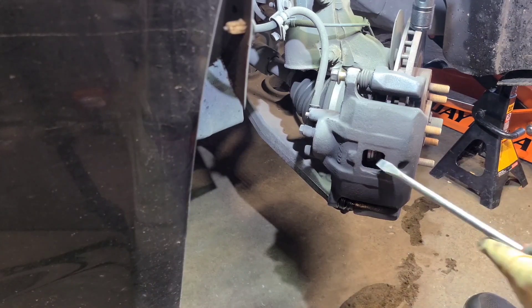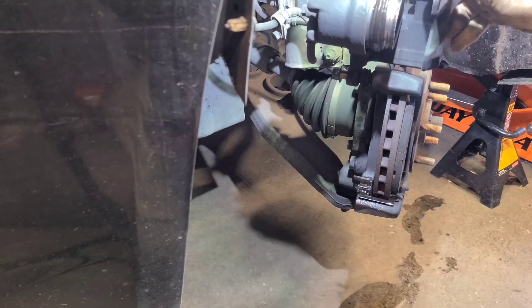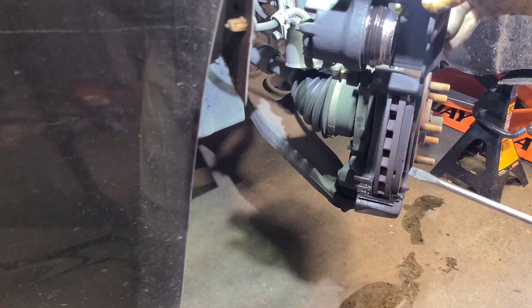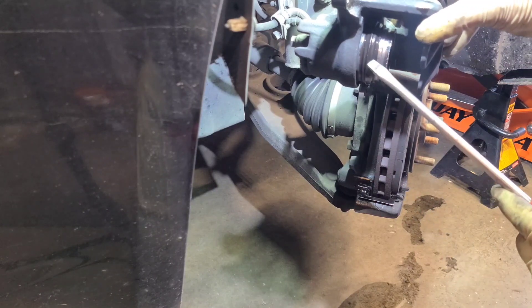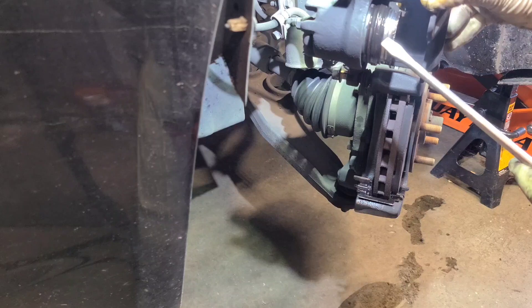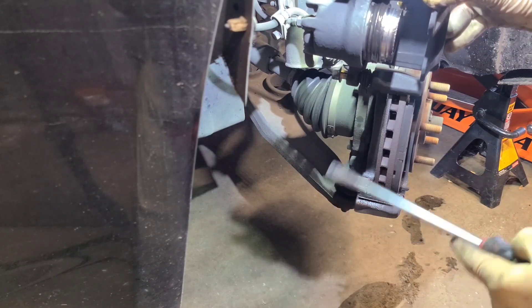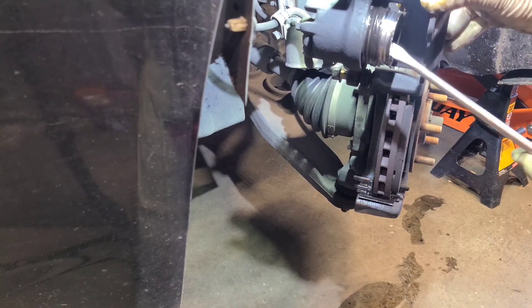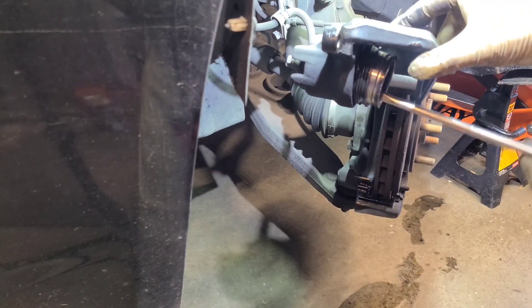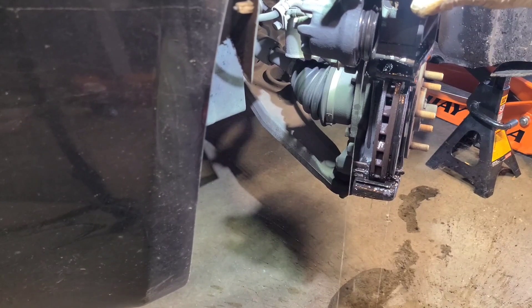The bottom's open so I can at least open it up and see what's happening. You see this right here — this is what happens when somebody forgets to put the pads back on. You've got one pad on this side and no pad on this side. The heat and metal-on-metal contact caused this to fail. We have a busted caliper. The only way to fix this now is to take the whole caliper bracket off and hopefully it's under warranty to swap it out.